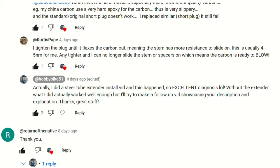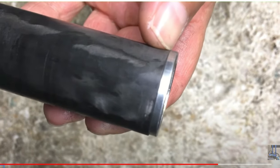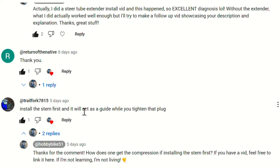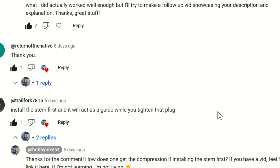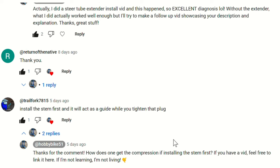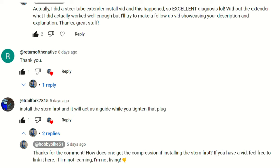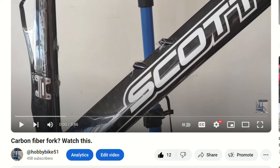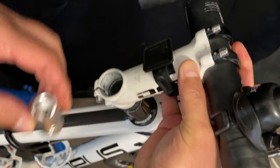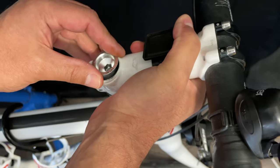There was another problem where the top of the plug was off center, so it wasn't flush with the steer tube top. Trailfork7815 says: install the stem first and it will act as a guide while you tighten the plug. I asked how one gets the compression if installing the stem first. I understand what he's saying, but you have to know that the plug will just fit right through the stem. So we'll just visualize it — and yeah, the plug fits right through.